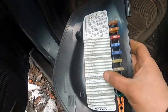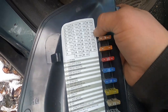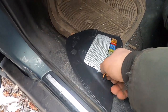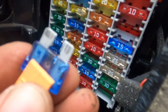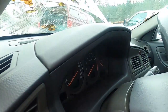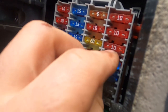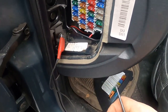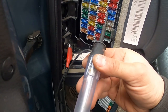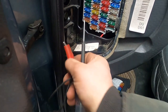The first thing we're going to check is the fuses. Volvo lays out all fuses labeled — thank you, Volvo. Fuse number 33 is a 15-amp fuse, and that's the fuel pump fuse. Let's pull that fuse out and check the integrity. Fuse is good — it's not burned. Let's put it back. Now we're going to check power to the fuse. I connected my test light to ground and touched the fuse terminals. We have power on one side of the fuse and power on the other side. That's good — we know that's not the problem.